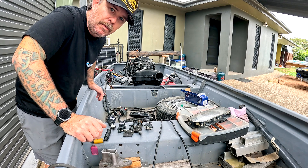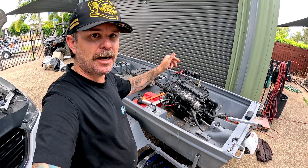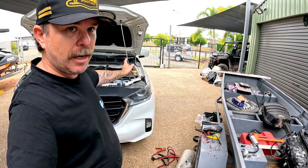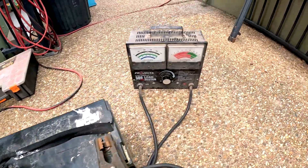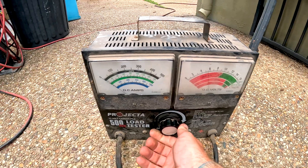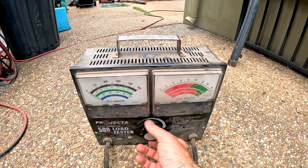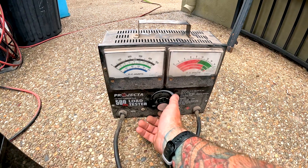After a bit of fault finding, I found that the AGM battery does not have enough guts to drive the starter motor - it'll drive the fuel pump, but I ran a jump lead straight from the ute to the starter and it cranks over fine. I thought I'd chuck it on the load tester - it's up there at 12 volts, but when you wind this up it's pulling down and pulling no amps. She's dead. I've also got this 100 amp Kings one lying around, but that's also dead. It's getting hard to find good batteries laying around - a battery sponsor would be pretty handy.